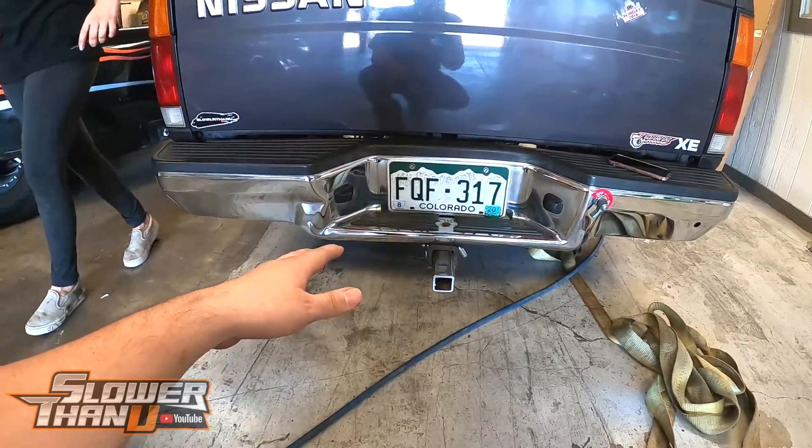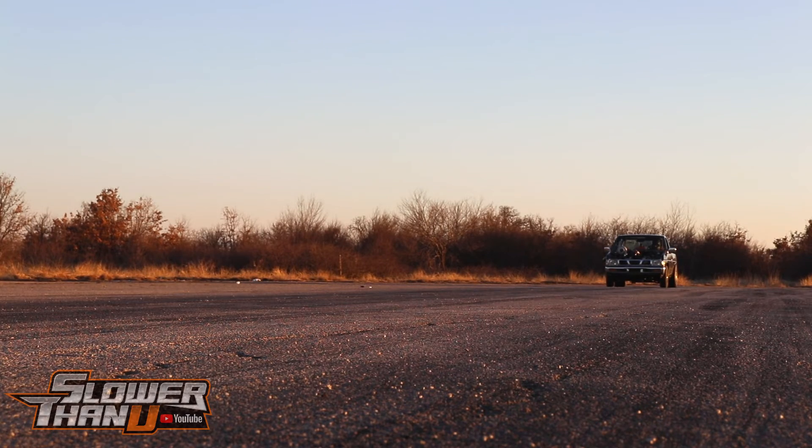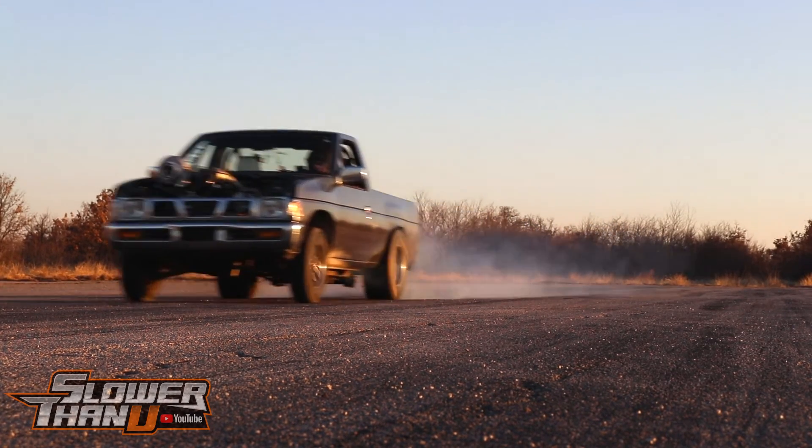Hopefully it's right around a hundred pounds. I don't want to add a crazy amount because I want some weight back there to help with traction. Keep in mind this is going to be kind of for mid-range and top end. A lot of people assume that adding weight is going to help with the initial bite — it's really not for that. It's so that we could pour in the power a little bit earlier. Suspension and tire is what's going to give us our initial bite. We tried to get it as good as we could, like at Mineral Wells on that really bad road. We got it to where that's the best I can do with the current suspension setup until we start adding some weight. So we're at that point now — let's add some weight.